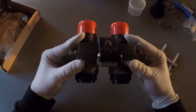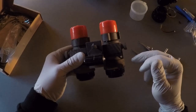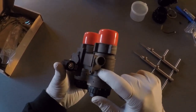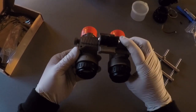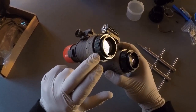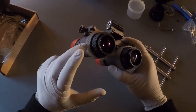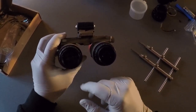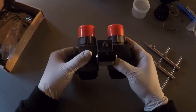This isn't necessarily the most professional way of installing it — I'm not sure how they do it in labs at L3 or ITT — but it works. You will lose your nitrogen purge if your unit was nitrogen-purged. There are DIY options for removing the purge screws and spraying something in to recreate it, but even without that, I've seen plenty of guys do the same DIY work at home without any lenses fogging up inside. I personally haven't had that happen even in a climate with rain and snow. Biggest thing is wearing gloves so you don't get grease and skin oil on the lenses or the image tube.